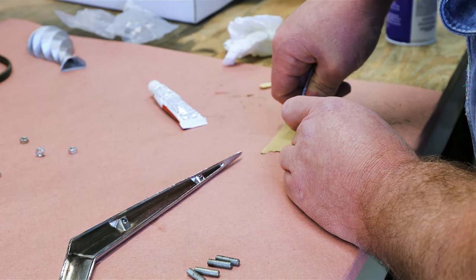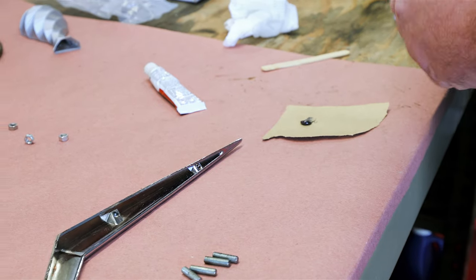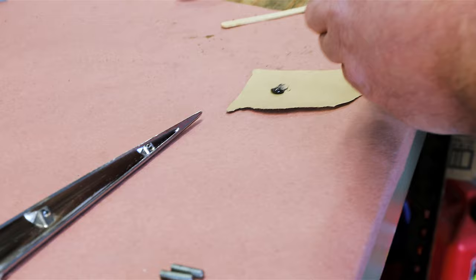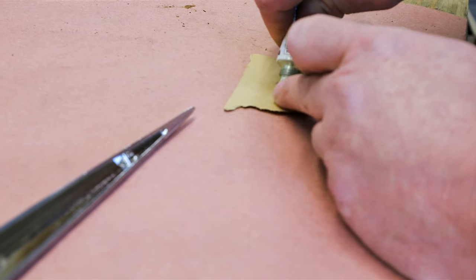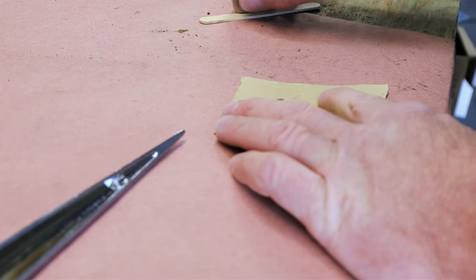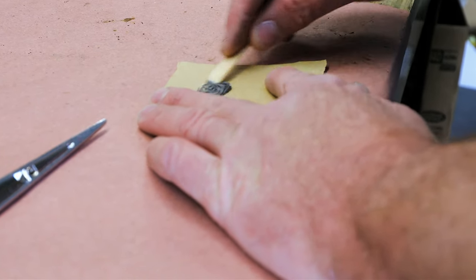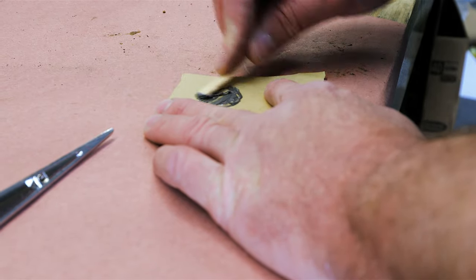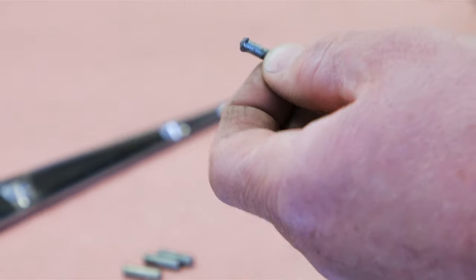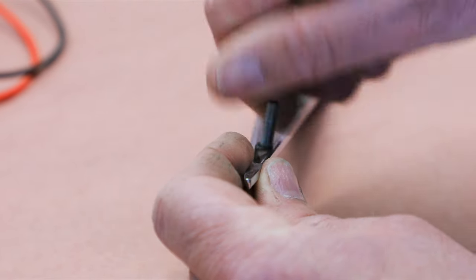See, if the part you're repairing is plastic, you're going to want to use something like denatured alcohol to clean it up. With a chrome part, carburetor cleaner works. So we're going to mix this up. A little bit of epoxy on the tip of the stud and on the first couple of threads. You don't want to overdo it.